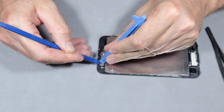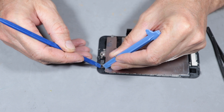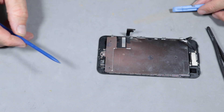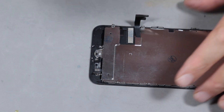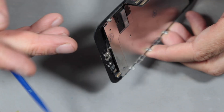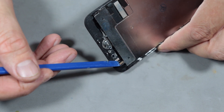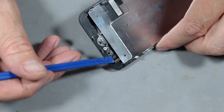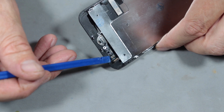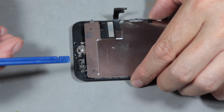Take the bracket out just like so — so easy. Push against the frame and lift this up. Let me zoom in so you can see. This cable folds over to its socket and is glued to the frame, so be careful when disconnecting — disconnect the plug from its socket, don't tear it apart. Alright, now we've disconnected the Touch ID.